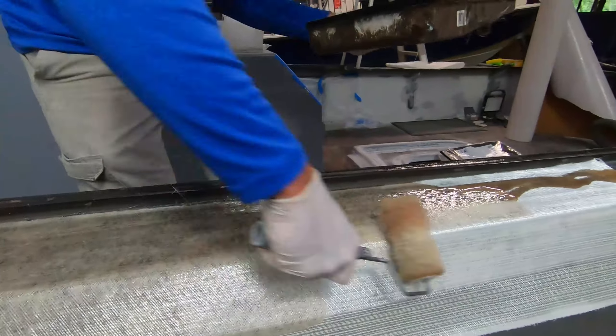We're going to wet out some of this mat using a pan and a standard roller. I like to use it systematically — start at the top, work my way down over the corners. Like my dad used to say: whatever is white, wet it first, just get some resin on everything and come back and work it. See how that transitions real nice — the biaxial ends and the mat transitions into it, leaving a nice feathered edge. That way when we pick it up next week it'll blend seamlessly without big lumps and bumps.